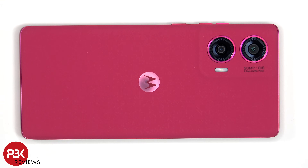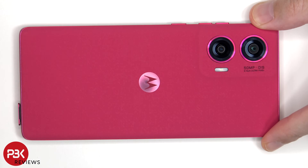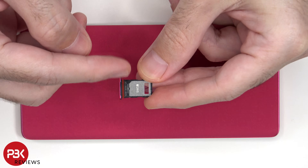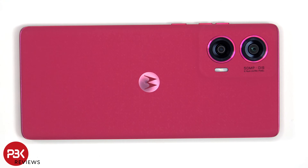We'll start off by removing the SIM tray. Looking at the SIM tray, we can see a red rubber gasket around the opening. Heat needs to be applied to the back cover using either a hairdryer or a heat gun to loosen up the adhesive underneath, and then a pry tool can be used to pry the back cover off. I prefer to use a hairdryer since there's less of a chance of damaging any of the components inside by overheating them.